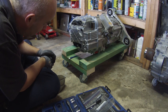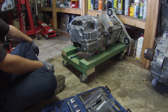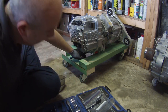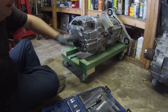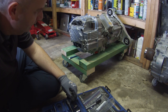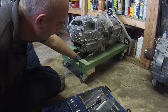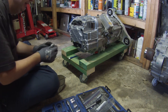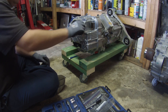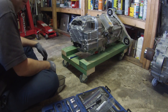There is some kind of a stopper in there, not sure what that is. One thing I should note is that I am probably going to have to deal with the orange plate down here - it is similar to the setup on the large drive unit, basically where the 3-phase connections connect from the inverter power electronics to the motor. I am going to have to lift this up, get in there. Let me pop this plate back on, get that plate removed and take the bolts out from there. Then theoretically when we take the 8mm studs out, we should be able to just lift this whole affair off.